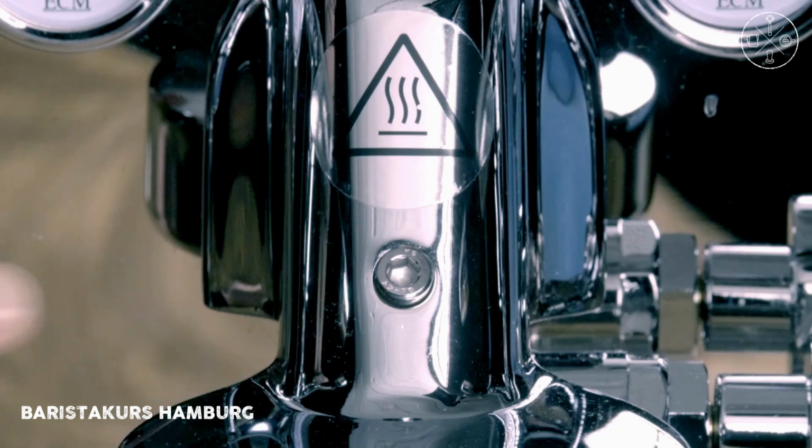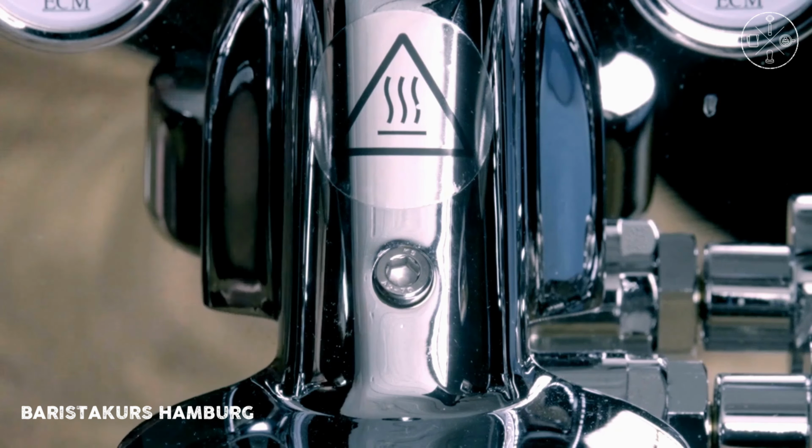So, not everyone has the opportunity to get a measuring portafilter. And it is also a relatively expensive undertaking. But there is a nice option. We have already made a film about it. Because you have this little screw on the E61 brew groups, and you can install a thermometer in this screw. There is a thermometer from Geisinger that you can simply screw in. And with that, you can really check very precisely what temperature reaches. For those who are interested, I will link the film. Then you can take a closer look at the whole thing.